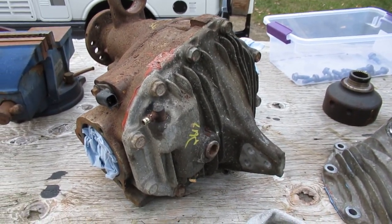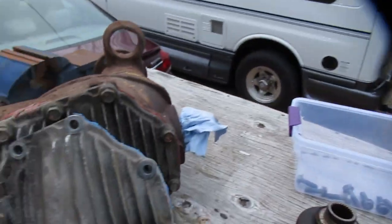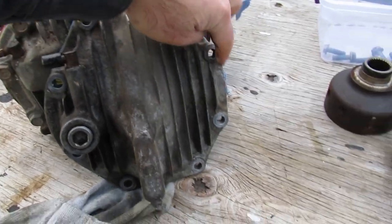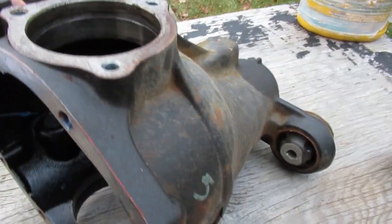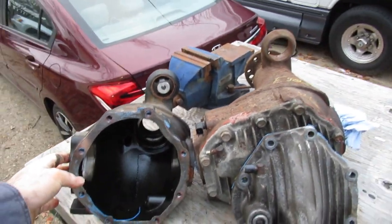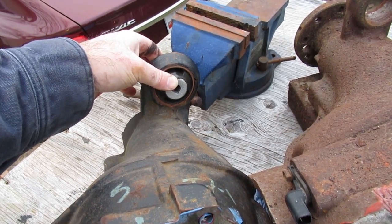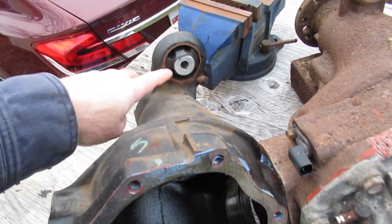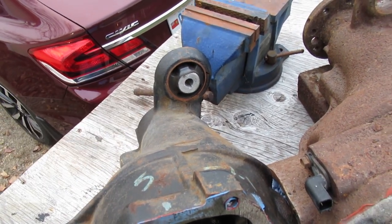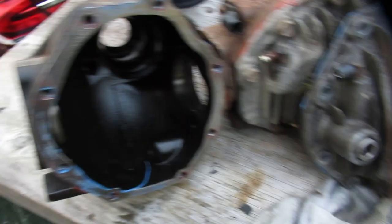There's a story behind why I own this differential - it's very sad, we'll get to it in a minute. This is the original differential that came with my Jeep. It's a little bit different - eight bolts here, and there's no electric locker on this one. What they have in common is they're both for Jeeps. One of the bushings here goes bad - this one's been changed. You can get poly bushings; I recommend OEM bushings or Dorman as replacements. Don't get the rubber replacements, they're not going to last very long.